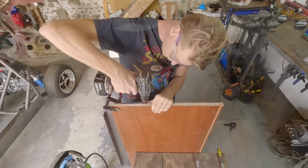It clips together like an IKEA picture frame. The clips are almost identical. Now we've got our heater support in place, we can put a bolt up on the top of here, we can weld one in captive. So then we can actually bolt the heater down. So it's bolted in three positions on both sides and then at the front. And that'll hold it super secure, and yet it's super easy to get all of. Literally, it's not even a 5 minute job to change the heater matrix now.